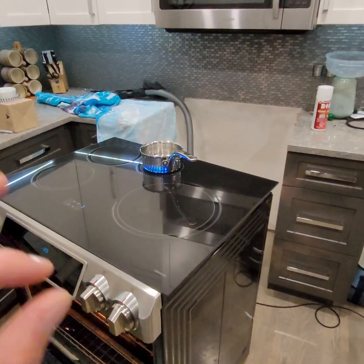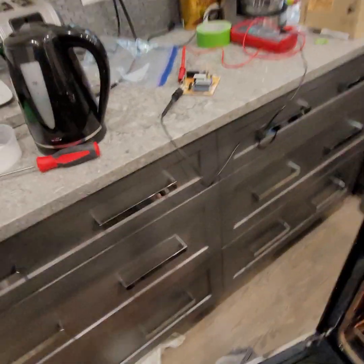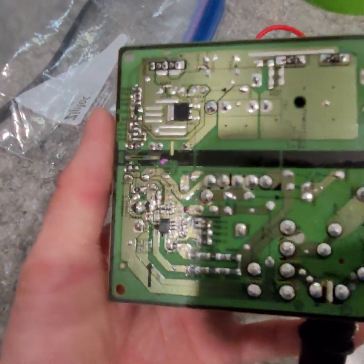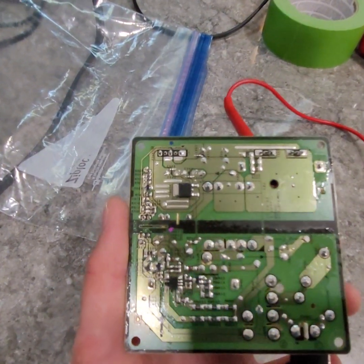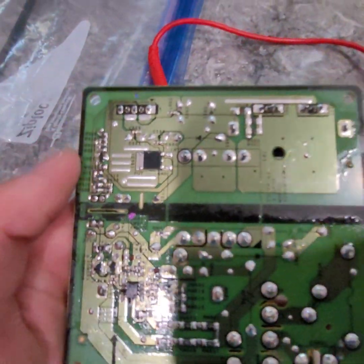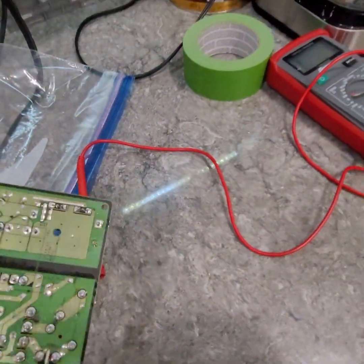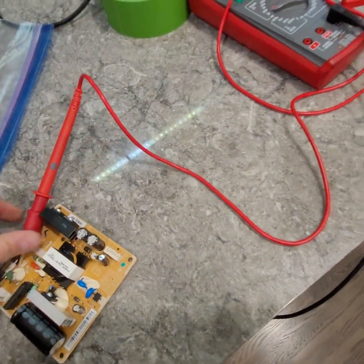One at a time I pulled the electrical clips for each board and then flipped them upside down, because I saw online that some had bad solder connections causing different symptoms — for example, it wouldn't recognize the pot on one of the burners due to a bad solder joint. You can see these are all good because they're nice and shiny silver, but on other people's videos the joints were yellowish-brown with a hole in them — just a poor connection that they were able to fix.